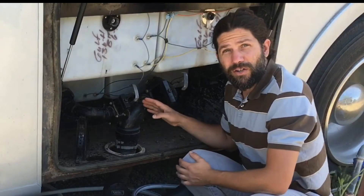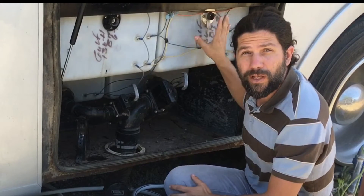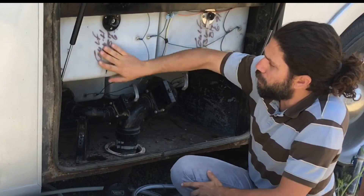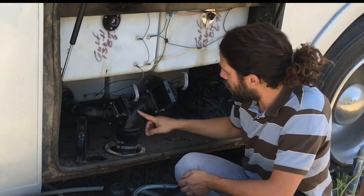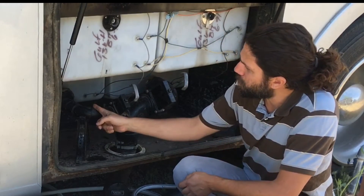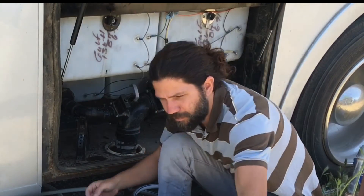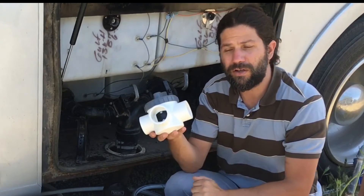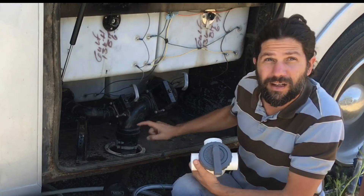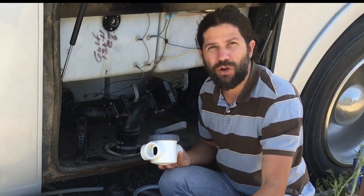The gray water tank is located here on our left, and then we have the black water tank on our right, which we're later going to replace with a composting toilet. For the gray water tank, there's one small hose that comes in from here, and then it's all funneled down to the main pipe, which then takes it down to the sewage. So what we're going to do is actually intercept this pipe with this little hub here, which will allow us to split it both to the main hose down to the drainage and to the actual gray water filtration system.